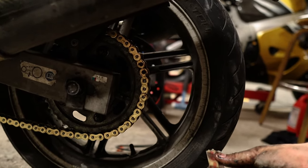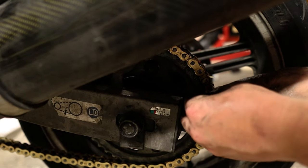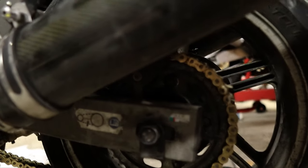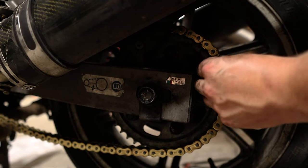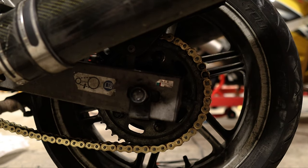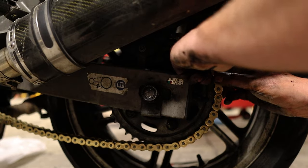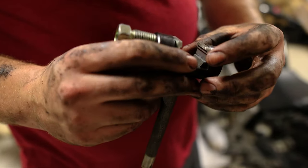Grease up these pins here and use up the last of your grease — you're not saving it for anything. Then put on your next O-rings, or whatever they are, they might be X-rings. Realize that you lost your face plate somewhere — get the writing facing out, and just press it on with your fingers for now. Then you need the actual press tool which is just going to press the plates together. This sits over the back — these are just to protect the rivets so you don't crush them before we want to.